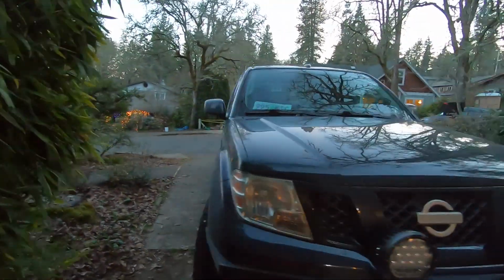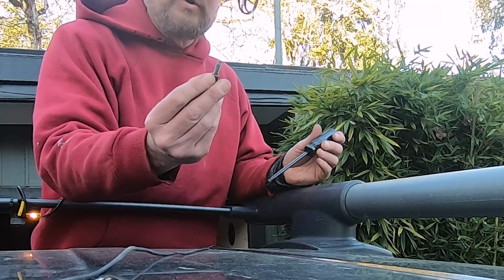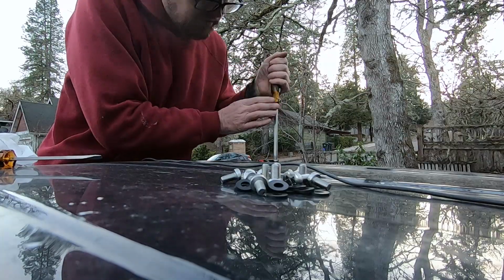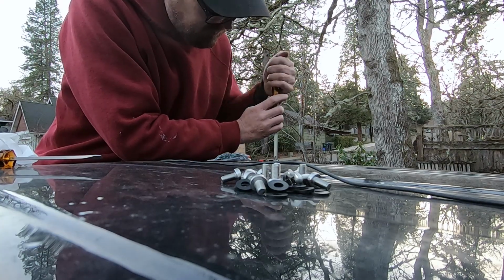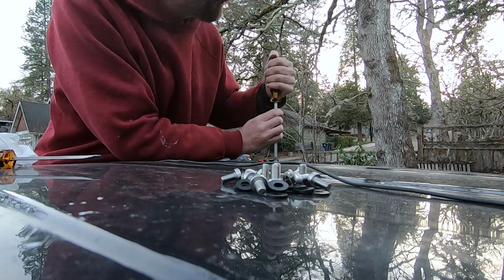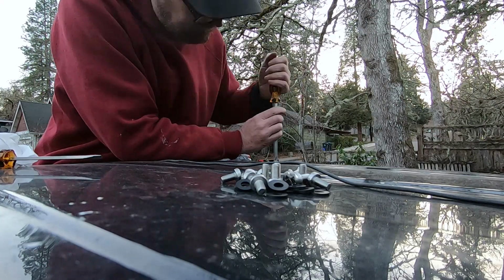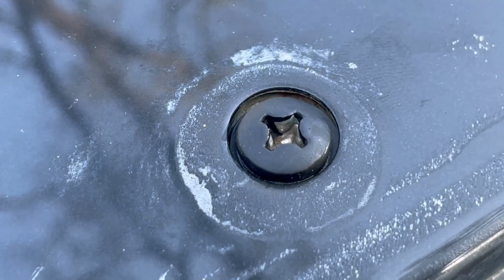the holes. The original bolts won't work because they are elongated to pass through the factory rack bases. So I got shorter stainless steel bolts and neoprene washers, which was the recommendation of the guy at the hardware store, who happened to also own a sailboat and had first-hand experience with trying to weatherproof various holes. I painted the bolt heads black to make them less visible.